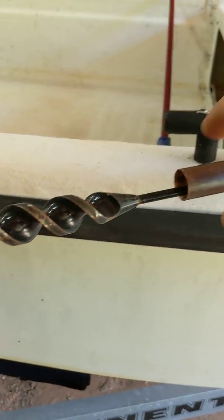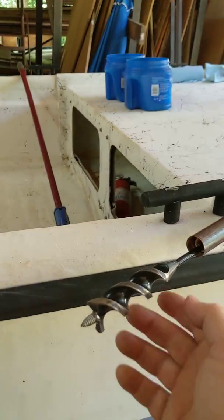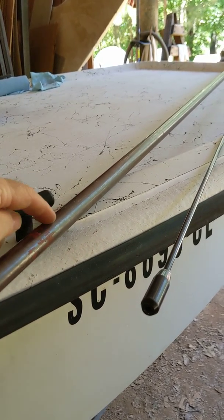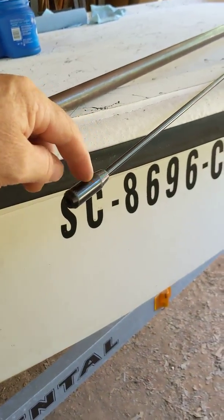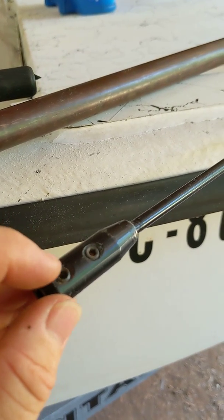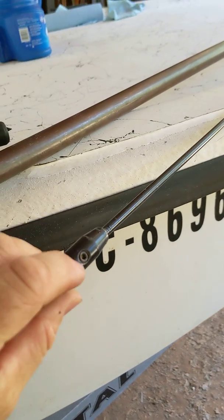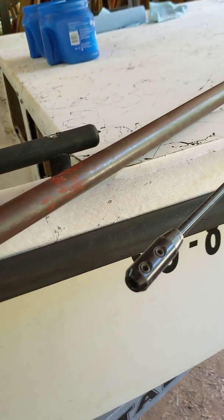So basically you can get somebody to help you and hold this copper pipe while the drill motor is on the other end spinning this. And once you go to the extension, which will be like 12 foot, you need a longer piece of copper tubing and another piece of 1/2 inch CPVC inside. You know, space it out around the joint where you screw this adapter on. This makes it longer. I bought a longer screw, and I sharpened the one that fits onto the drill end. There's a hole. This is hardened, but there's a hole on the other end of this one. So I just set it up where this sharpened set screw goes down into that hole. So if it did come loose somehow, I have a better chance of getting it back out of the boat.